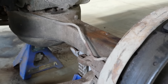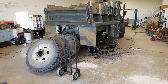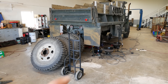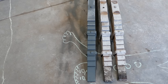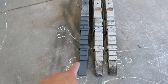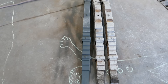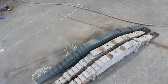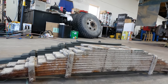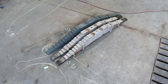I did make one other discovery. The perch where the spring sits is pinned to the top of the axle and the pin has had a bad day. You can see in the bottom of the perch it's actually egged out about half the diameter of the pin. I don't think there's any way to really fix that — we're just going to have to line it up, take a measurement off of the backing plate to the pin, do some dead reckoning, tighten it down, and it should be good enough for the purposes of this truck. It's not going into commercial service or anything like that. We're also going to reverse the springs, flip them end to end so we use the unworn side towards the inside where it rubs on the inside of that perch. Also the springs we're putting in have quite a bit more arch — about one leaf taller than the old spring — so it should pick the back end of the truck up a little bit, which is always a good thing.